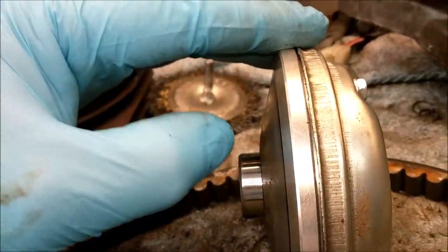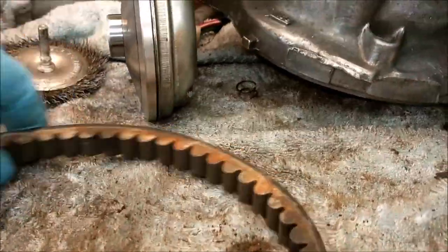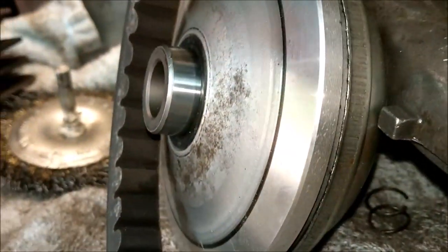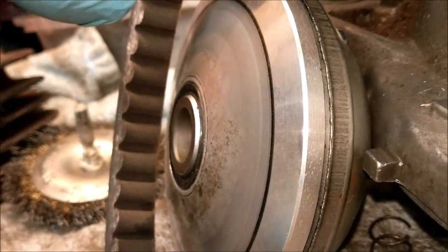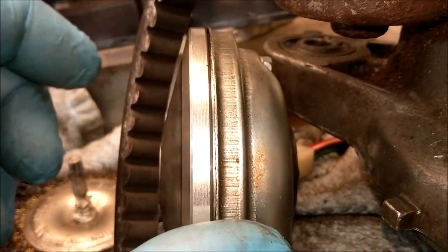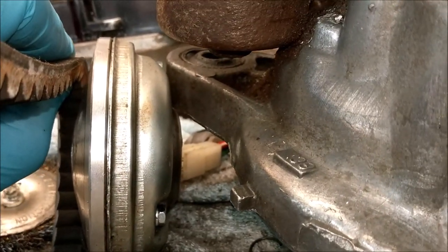So when it's there, and the other half of this angled variator is here, same angle as that here, the belt obviously is down there. Let me just put that there and put that like that, you see. So that is effectively there. Okay, like that. And as the centrifugal force pushes the rollers out and that opens up, this plate comes nearer, obviously, because it's touching this plate here, closes up that gap, doesn't it? It goes like that, which forces on this angle here, which forces the belt to travel from there up to there, yeah? Because this is effectively closed like that.